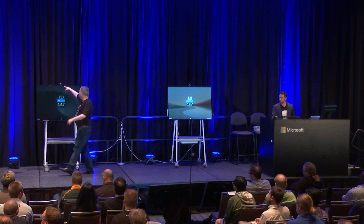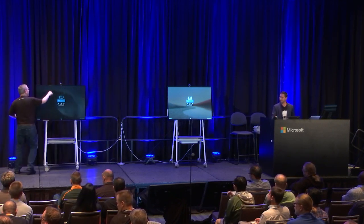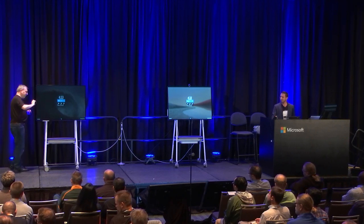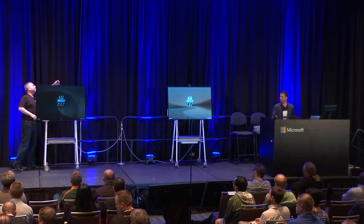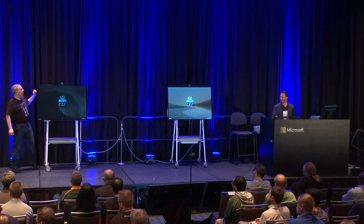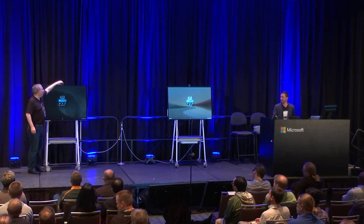We have gone in, put the camera up top, by the way. USB-C camera. It is removable. If you want to put it on the side, you can certainly do that. If you want to put it back, that's great as well. And I'm just not quite tall enough to do it from the front. We have put a magnetic breakaway mount on here. Why? Because if it's on the side and you're rolling the hub through a doorway and you smack the camera into the doorway, you want it to break away safely and not damage the camera.